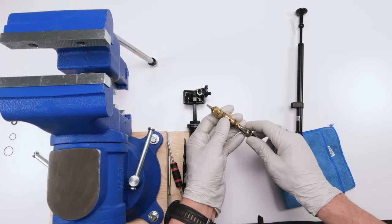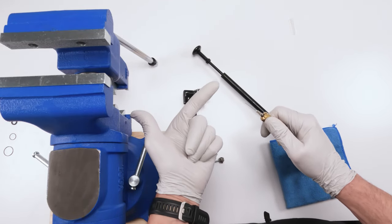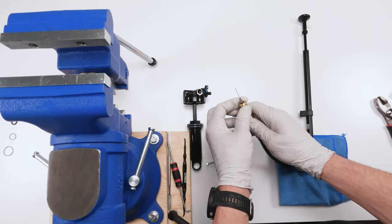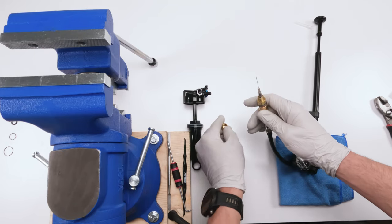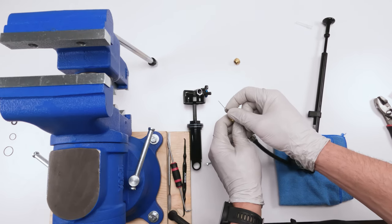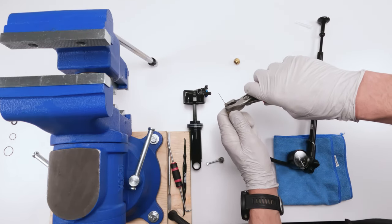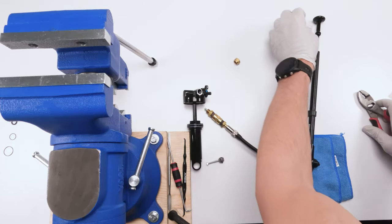I will be back. I'm gonna record this so you could avoid doing the same mistake that I did a long time ago where this needle went right through the middle of this finger. How it didn't get stuck in my bone, I have no idea. So basically grab a plier, loosen the head, all right? When this thing comes loose, take it off, put it down. Now, do not try and remove this with your hand. This thing's gonna be in there pretty tight, and basically it could slip off and then your hand will just naturally come back down potentially, right? So use the plier and just take it out and put this guy on the side.